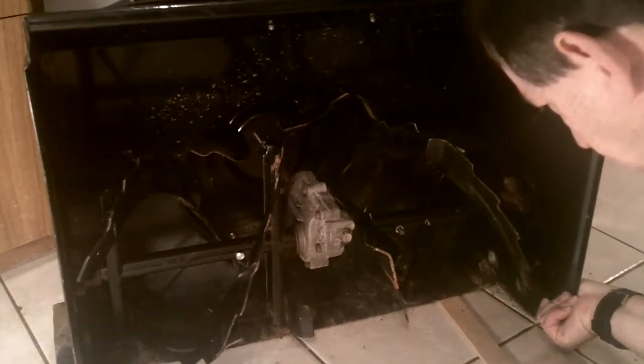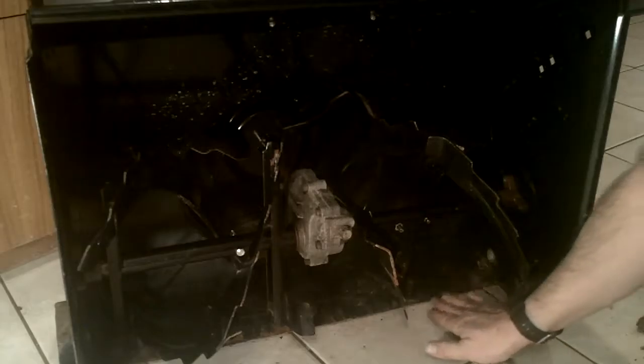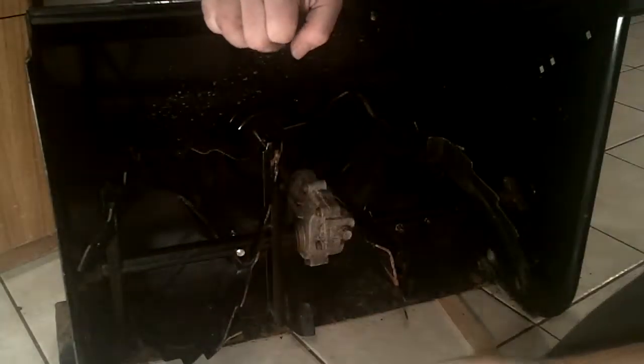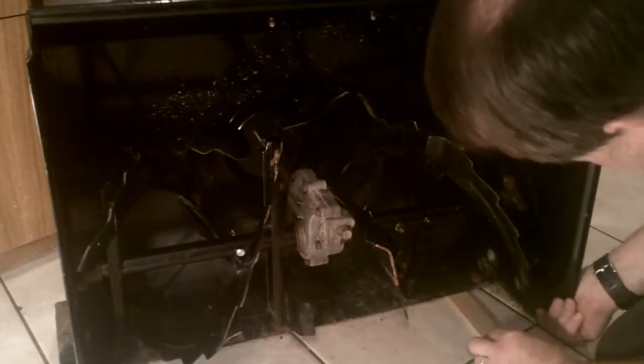Actually, I'm going to go just a little bit thicker than that. Let's go about 1 inch past the line. So you got to lift up, putting one of these shims at each side. That would be 1/8, go 1 inch further. Okay, so now this scraper blade is a little more than 1/8 of an inch off the ground, all the way across. And it's not really sitting on it very hard. Push it out a little bit.